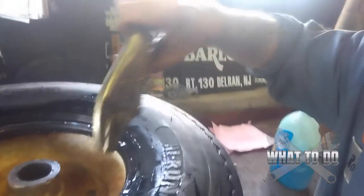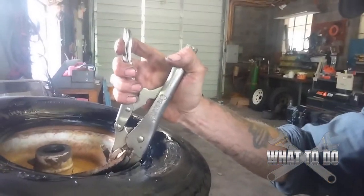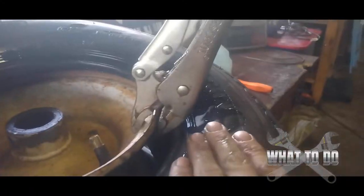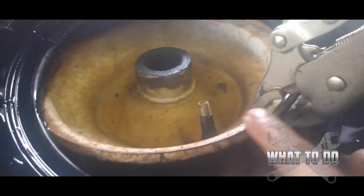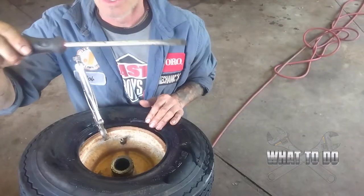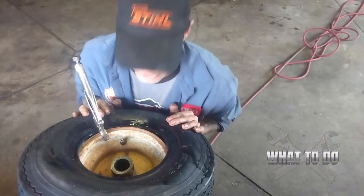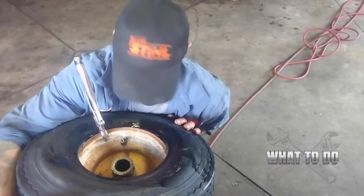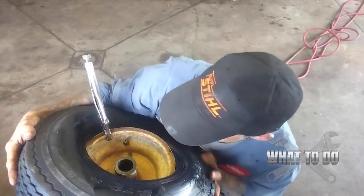Where most people struggle is this next stage. You're going to want a pair of vice grips. The front of your tire is going to look like this — see how I have the vice grips flipped upside down? You're going to clamp them on the rim right there, because it actually pushes down on the tire. Have your vice grips about two inches away from your air nozzle, and have your screwdriver handy because you're going to need it. Push in on this tire and kind of turn at the same time — see how that vice grip is pushing down on the tire.